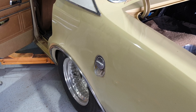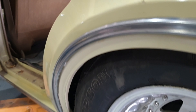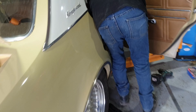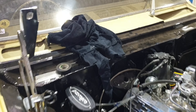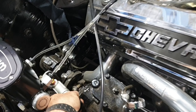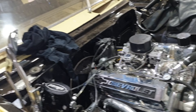Rick's under the pump — he's done as much as he can to get this ready. It's got to go back to him after the show. We've done a little bit of trimming on the inner guards so the wheels don't hit — the tyres won't scrub so we can drive it. I've just got to fit the brakes up. Brad's brought back the Wilwood brake master cylinder. I've got to hook up an adjustable brake bias switch — going to make a bracket and bolt it on there.